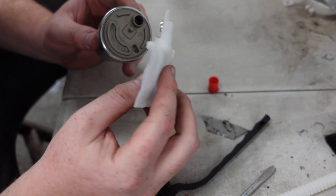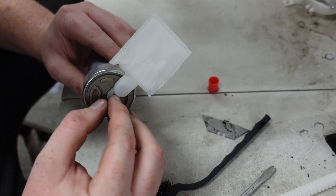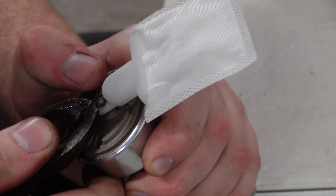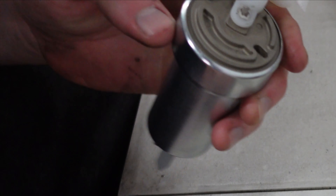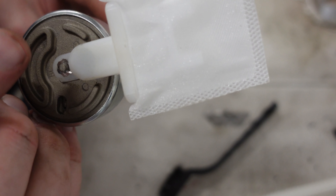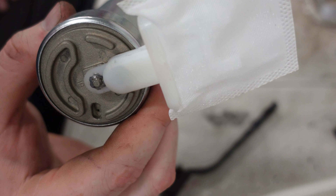Here's the fuel pump — I think we pretty much just stick that on like so, and it looks like this little washer just gets pushed over. We've got it on and it's not coming off. I found the best way is to get a little bend on the star, then push the inside of the star — the bent bit downwards — and then push the edges flat. It's really clamped on now and it's not coming off. We'll put it into the outer housing and put it all back together.